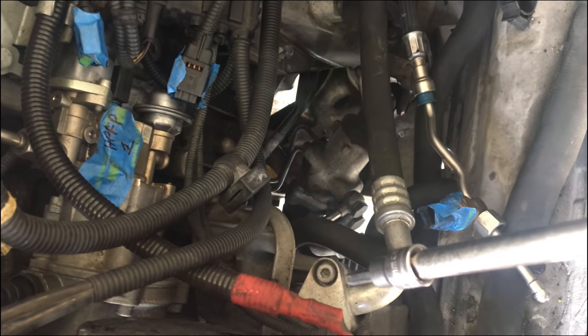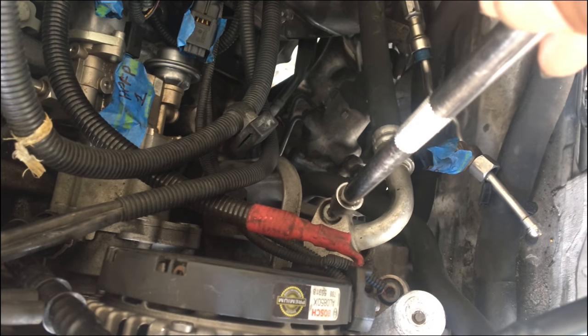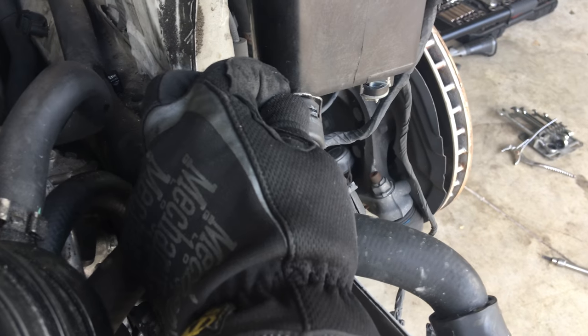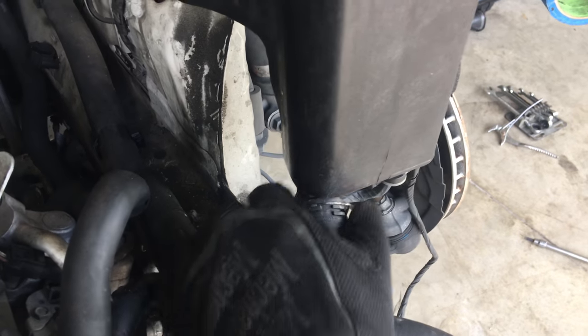I'm going to go ahead and take this AC line off the AC compressor using the number 6, and move it off to the side next to where the fuel line is. To finish up the coolant system, I'm going to remove this line right here — it runs all the way over to here. I use a flathead to pull this latch piece off, and all I have to do is pull it off and it comes right off the block. Up here in front, I pulled this up too to remove the feed line for the coolant reservoir. Mine's relocated, so I'll just take these off and then take the other one off down there.